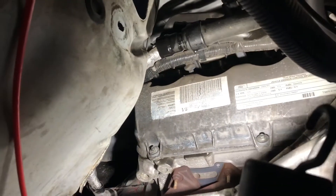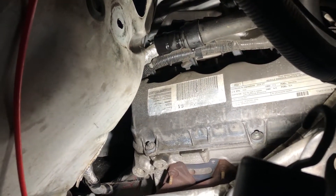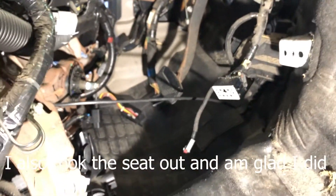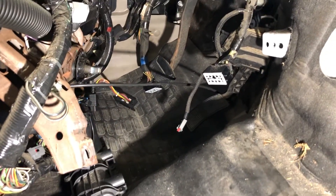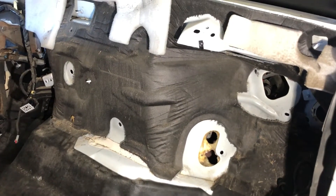There's another video on how to remove your dash that's really good — that's how I was able to do mine. I didn't take my dash all the way out. I left the shift cable attached and just kind of laid the dash back, popped it loose from all the little holders. There's plenty of room, and then I was able to access this area to change my evaporator.